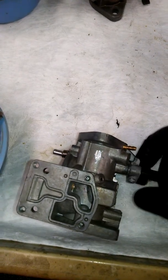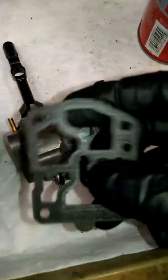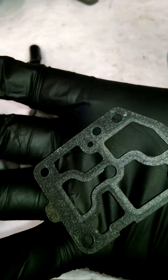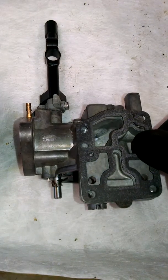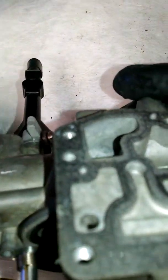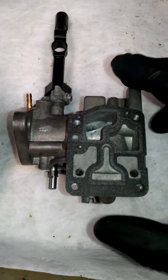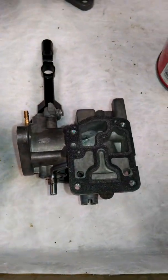You don't want to get stuck at wide open throttle. So what I'm going to go on to next — if you remember these little gaskets, we're going to reuse these. There's absolutely nothing wrong with these and I think they'll hold up just fine. We're going to place these back on here. You've got two little cast-in locator pins — one here, one here — just kind of set it on there and make sure you're pressed all the way down. Take our plate.